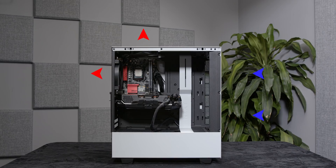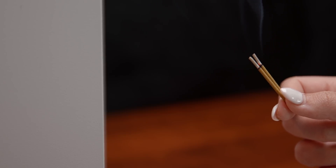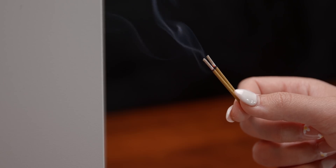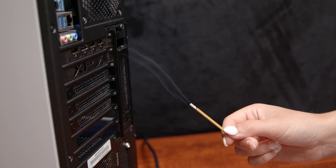A fan sucks in the exact same pressure as it blows out. When the inside of a PC case is under negative pressure, it tries to reach equilibrium with outside pressure by sucking air in wherever it can. Air is lazy and takes the path of least resistance. So as long as the side panels are airtight, air will only come in through the intended mesh-filtered inlets — in theory. Using incense sticks to visually examine the smoke, we can see it does primarily intake from those mesh-covered inlets. However, a mesh filter increases resistance, so a lot of cool air actually gets sucked in unfiltered at the back by the GPU slots.